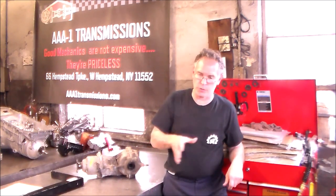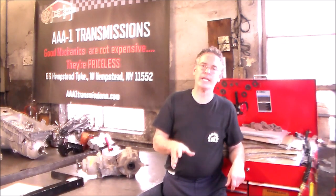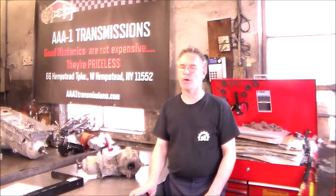My suggestion is you keep these tires rotating so they wear evenly, and then when you're ready, get all four tires put on — that's the correct way to do it to avoid a $2,000 repair. We've had a Hummer come in here where somebody put two of the wrong tires on, and that guy had to go for two new tires, a transfer case, and a front diff. It was like five grand by the time everything was said and done.